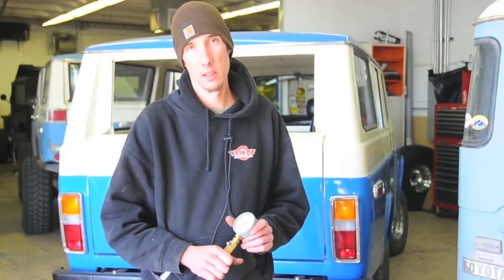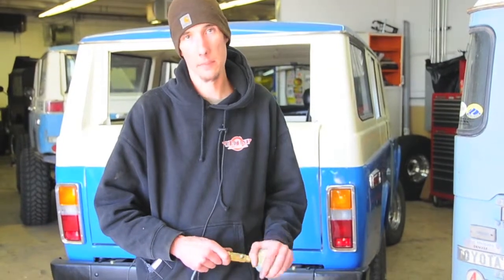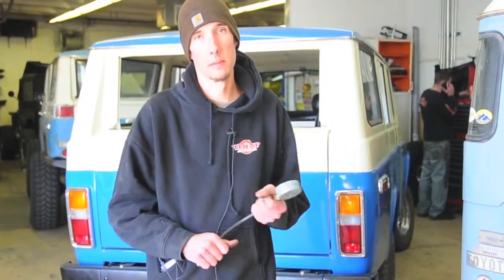What numbers would you want to see? Anything between 115 to 120 would be nice; 125 to 130 is good; 140 is even better. Anything below 110 — for me that's kind of the line where it's just old. We put fuel injection kits on straight sixes and if they're below 110 I won't do it, because the motor will never run right — it just doesn't have enough pop. They still run and drive down the road, but they're just not fresh anymore. They're 40 years old — what do you expect?